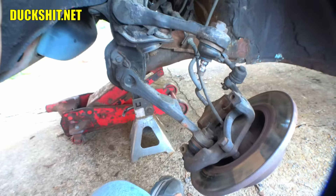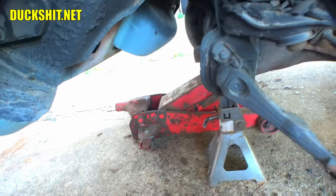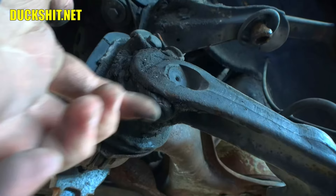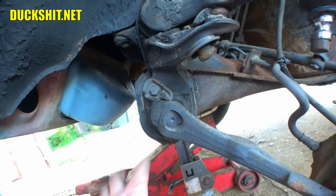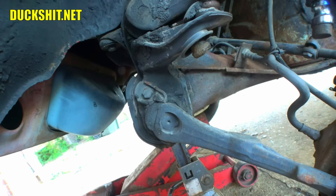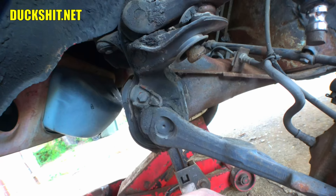We're going to take the little indexer off because it's in the way, then loosen the grub screw up under here — it's covered in undercoating, tar, and road grime and needs to be cleaned before I can do anything with it. Once removed, the entire arm can slide off the torsion bar. These tend to rust on, so I may have to do some beating. I'll also chisel a mark on it so we know our starting point if the arm comes fully off.